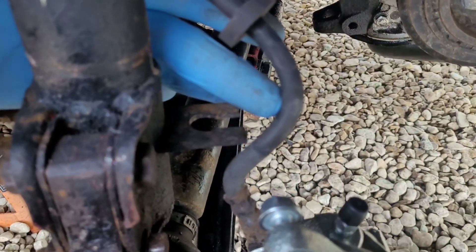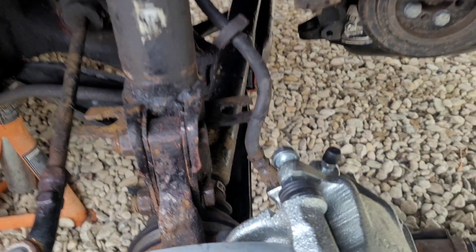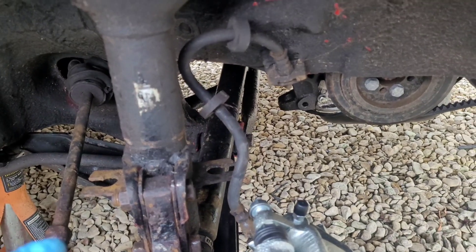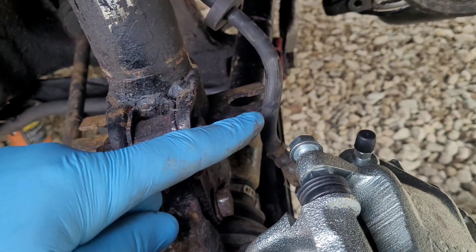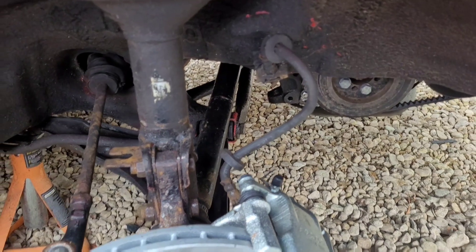Now, brake lines — you can use stock brake lines, but as the caliper sits in a different position it's going to foul and catch. You want to get that bracket out of the way. It holds the brake pipe, but it also runs a risk of cutting it when you're turning and going over bumps, which is not what you want. So we need to get rid of that — it's removed and smoothed off so there are no sharp edges.